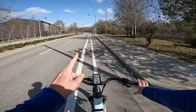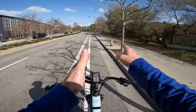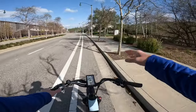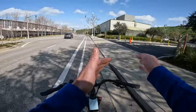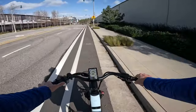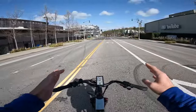One thing to point out is when you're going that fast on an e-bike — once you start hitting 23, 24, 25, or 30 miles per hour — the faster you go, the faster it's going to drain your battery. Basically exponentially faster because of wind resistance. It takes a lot more power input to maintain higher speeds on electric bikes. Speed kills range.